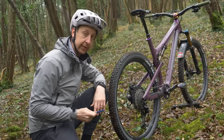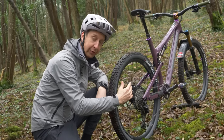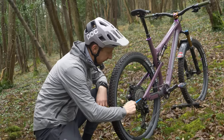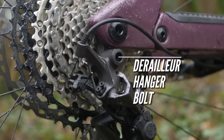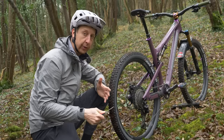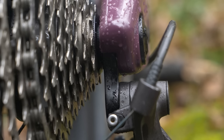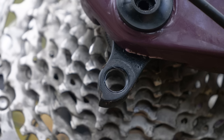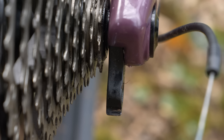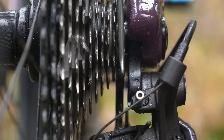We've had a bit of a hardware check. The next thing is to make sure everything's actually in line — fully aligned and the derailleur is actually fully mounted to the frame as it should be. If you look up close here, you have your derailleur hanger bolt. It's typically a 5mm, sometimes a Torx T25, and that mounts this to the hanger that's part of the frame. The way the hanger mounts to the frame differs on certain bikes. On bikes with a quick release, you'll often find it has just a bolt or maybe two bolts to hold it on, so check those. If your bike has a bolt-through system, it's going to be intrinsic with that. Whatever system you have, make sure the hanger itself is straight and make sure it's solid. You can check the alignment by looking at the gap between the smallest sprocket and the hanger itself — make sure that's completely in line.